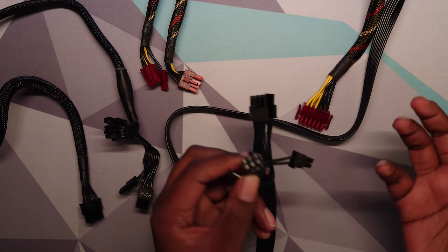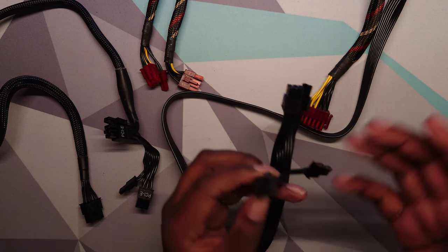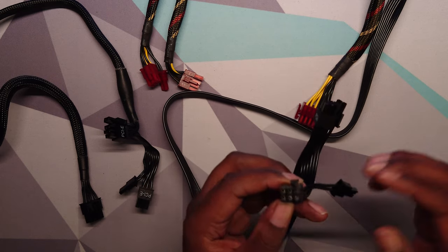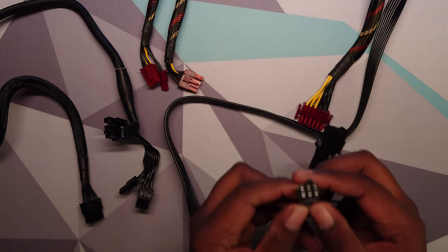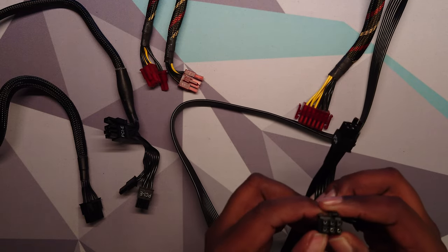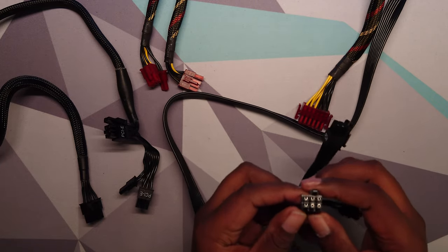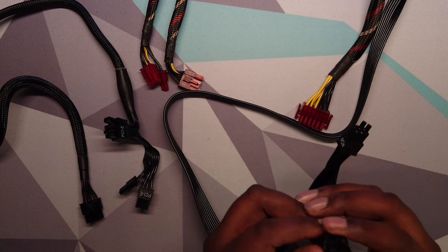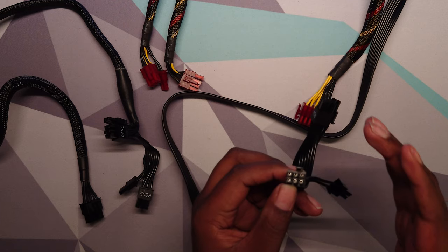This is mostly because the specification isn't really saying the cable will break apart if you go over it. They've just calculated it based on the rule that if the whole connector itself rises more than 30 degrees Celsius, that is the limit for the current rating of these connectors. This is the actual specification — it's what they allow you to use these connectors for.